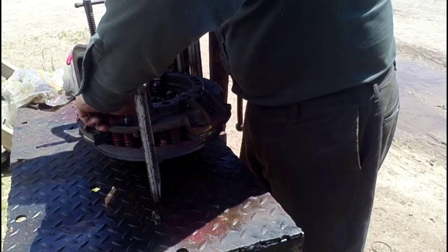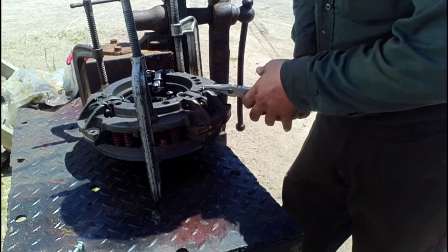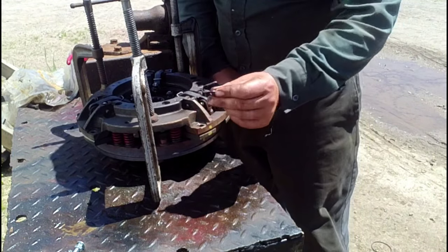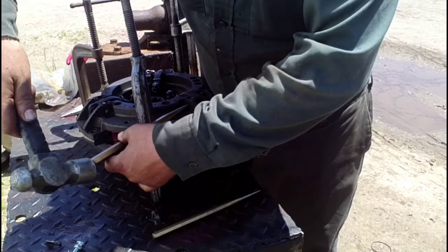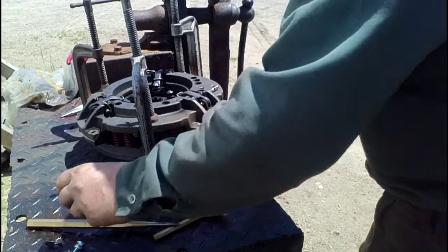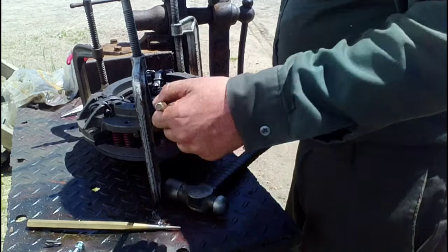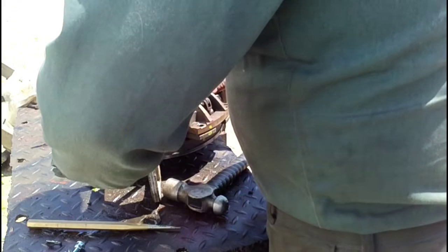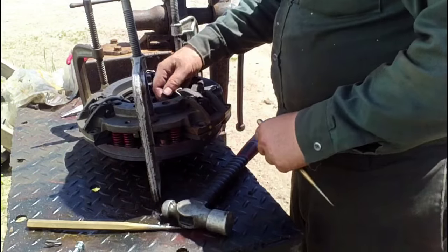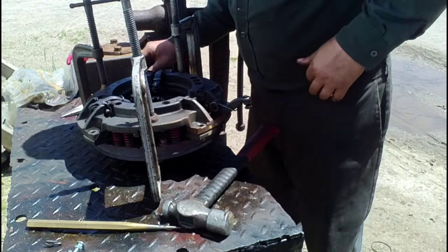Save those carefully because you'll need them to go back in. For getting those pins out, I'm going to take the pins out of the top on the levers up top here. These have a kind of a spring clip that holds the pins in place. Try it with a little punch. That frees up the levers. Just repeat the process through each one of the pins.